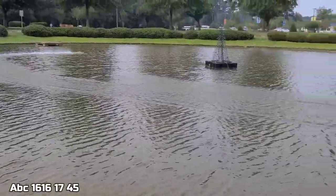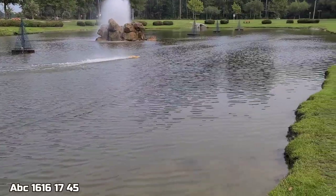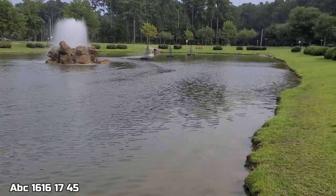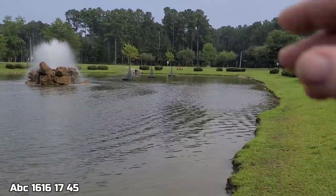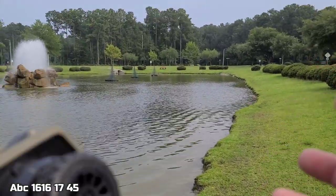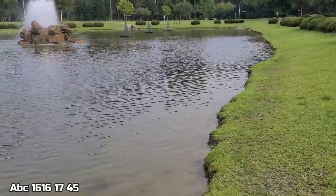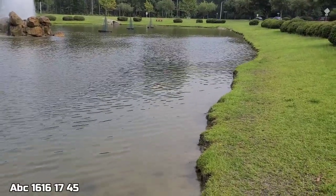Wow, got some prop walk on that one. Actually looks like it has more prop walk than the 17/16 - I think it's only because the 17/16 I really thinned and profiled it to a tee. This prop here is rather rough - the blades are still kind of thick. It's sharp, balanced, and polished, but the blades aren't as thin as the 17/16 I ran in the previous video. That boat handles so good with the 17/16, and I think it's due to the thin blade.